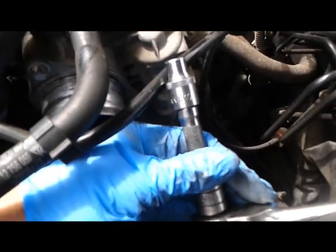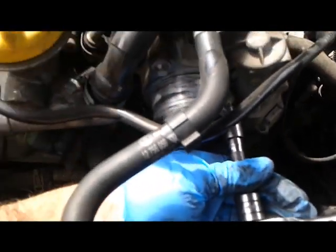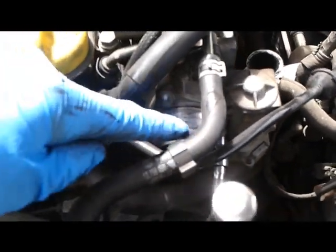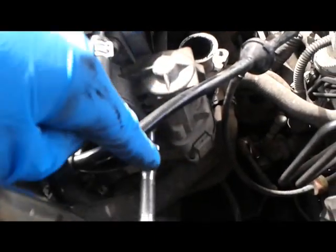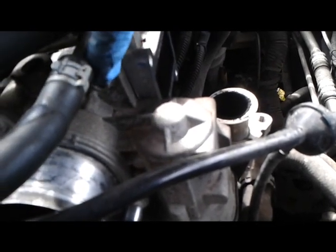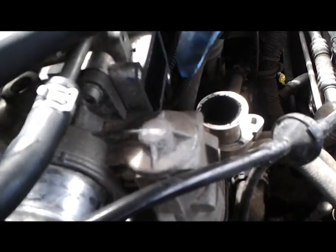These fellows down here are called an E10. These parts are to remove the throttle housing. There are two bolts that hold on this aluminium part here — that's one bolt and that's the other down here. And then I'm going to remove these little Allen bolts in here; these are like a 5mm Allen bolt. That will give me access nearer to where the soot is.